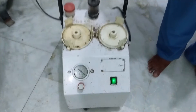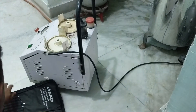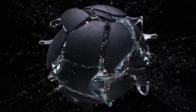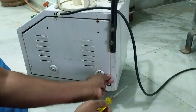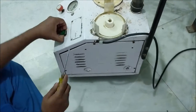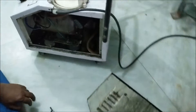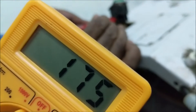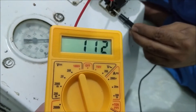For convenience we have already taken out its jar and tubes. Let's open the side panel of the machine and the on/off switch. First of all, turn on the switch and check the continuity of both its poles with the help of a multimeter. You can see that the on/off switch is fine.